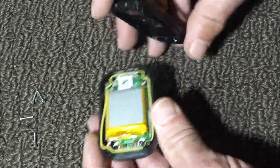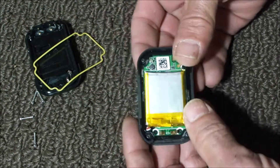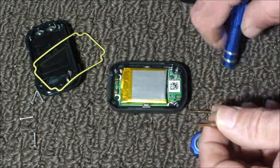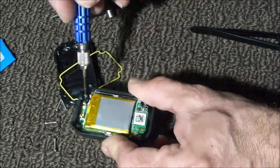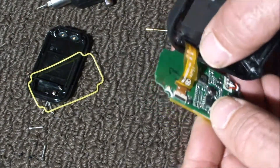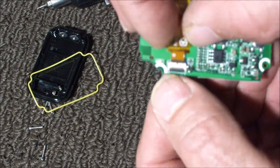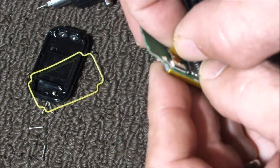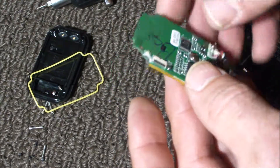Let's see what we've got. It's nice to have a seal. And you can see there are four very, very fine Phillips screws holding that circuit on. What you'll find is the circuit board is attached to the case with a very fine connector — you can see this right here. The wiring will actually slide right out; it's fairly easy to get the circuit board disconnected.